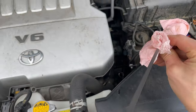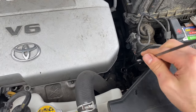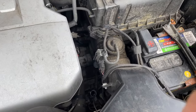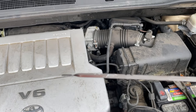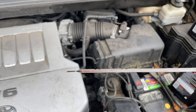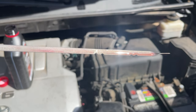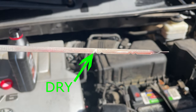After driving a couple miles, pull your transmission dipstick out and wipe it off. With the engine warm and running, check where the level is on the dipstick when you pull it out now that the engine is hot. You can see where it's at — it's right where you can start seeing dry, so it's nowhere near where it needs to be, so we're going to get our funnel and add some more. In order to test the transmission fluid level, drive a couple miles and get your engine to normal operating temperature. Leave the engine running and check where the level is on the dipstick — the fluid should be between the two notches marked 'hot.' If you see any spot where it is dry, that's how you know the level of fluid in the transmission.